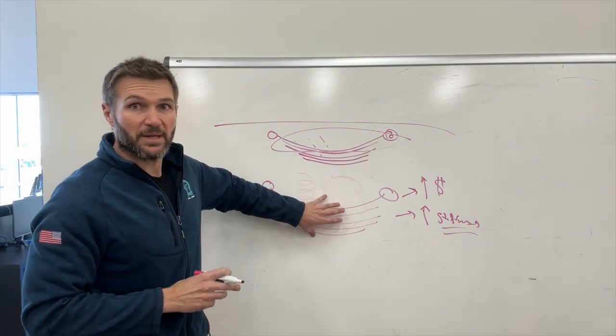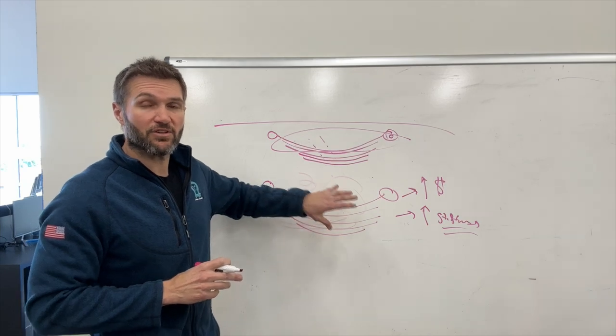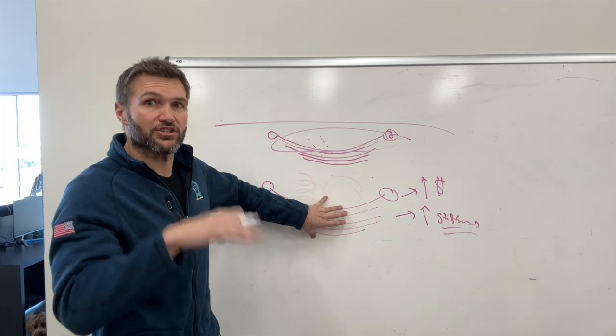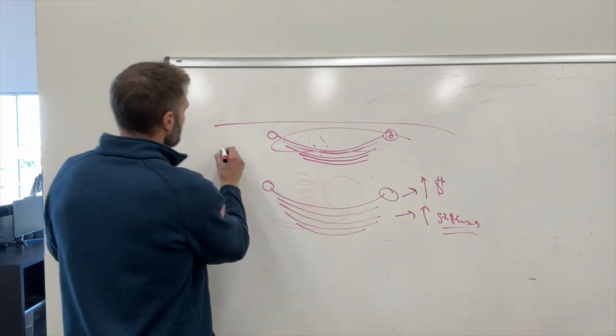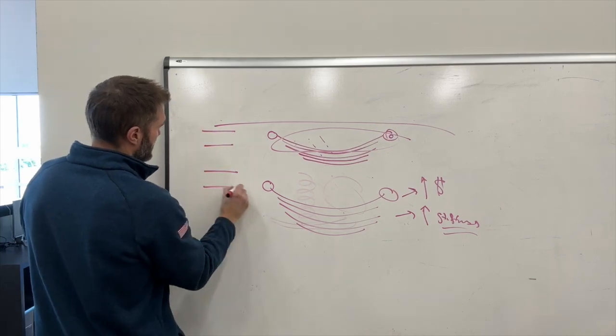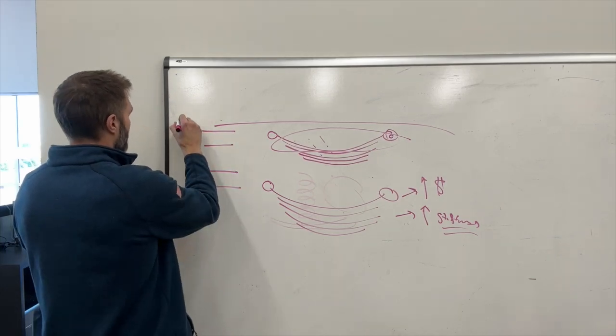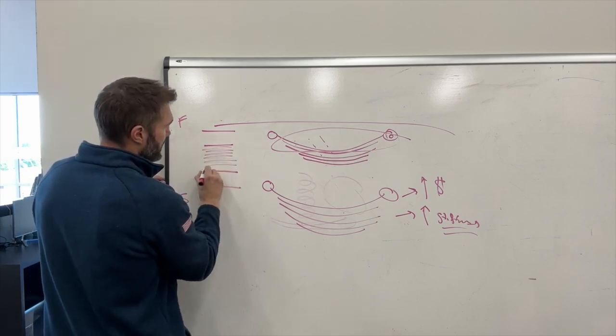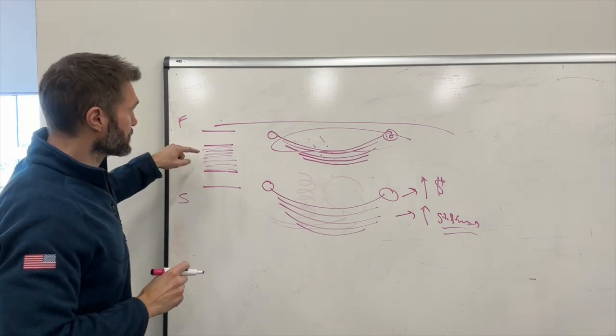This, unless you've got an incredibly heavy van, is going to lead to an incredibly stiff ride. It's too much spring. It's gonna get very jarring. There is a window that you want this suspension, and this is gonna be soft and this is gonna be firm, right? So this is the window that you want your spring rate to be in.